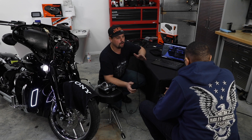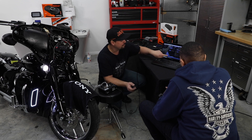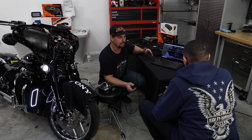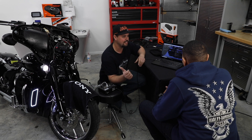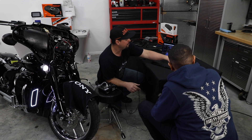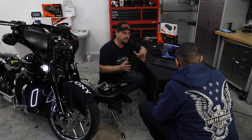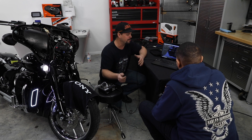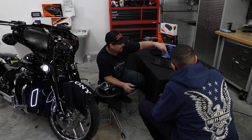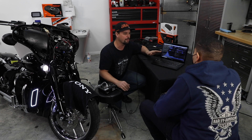There are a few things Harley's done here that people don't take into account. With a DSP, you can grab each frequency and adjust them up and down by boosting or cutting the signal. On this particular bike with this GTS radio, flashed factory for just two speakers and no amp, we have a pretty flat range from 200 hertz to 20 kilohertz — that's the vocals of most female singers all the way up into the treble and cymbals. As we come down from that to 160 hertz, we see a slight bump.